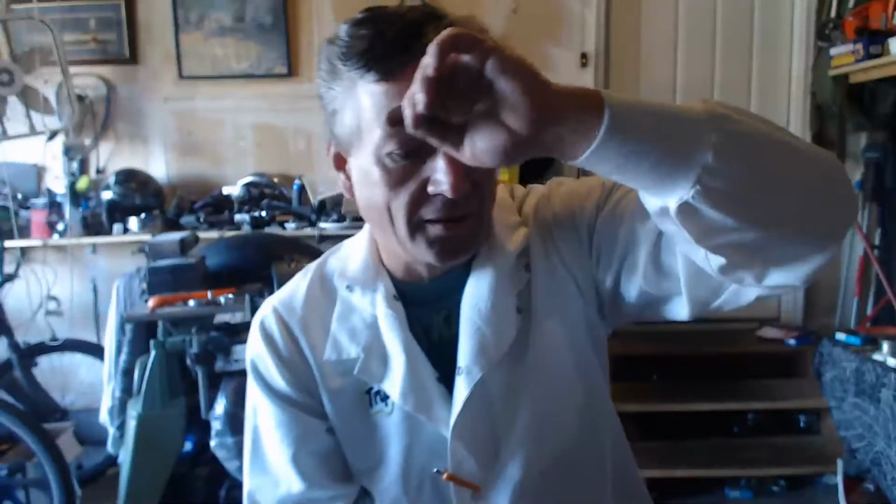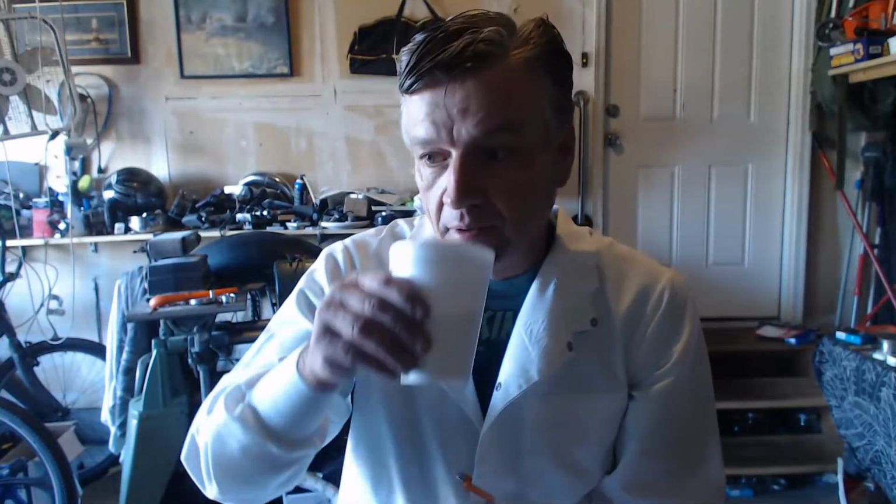A daily is something that I build to ride daily, to ride every day. I want dependability and nothing else. Dependability, no pedaling, that's a daily. And a cylinder that doesn't have to be opened all the time, that you can run a good 1,000 miles on before you have to rebuild it. And that's a good daily. I like the 400 as a daily. I really do.